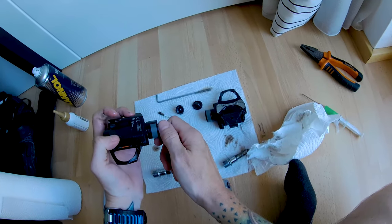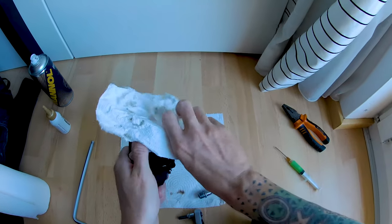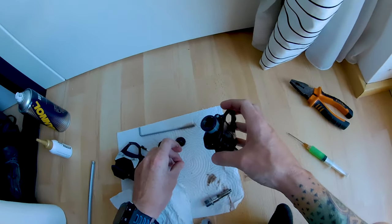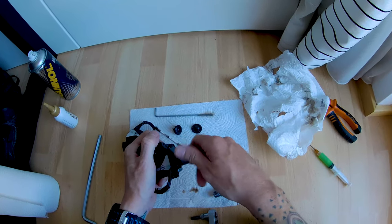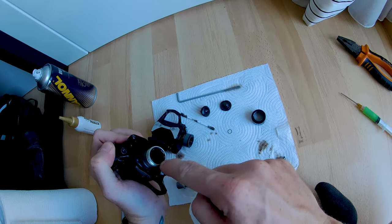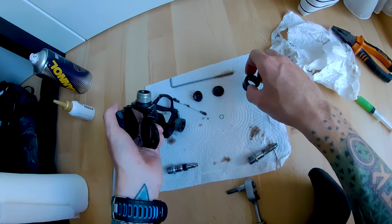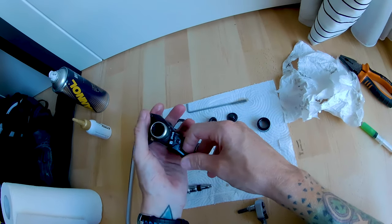Here is another ring — it's a little bit oily and a little bit hard to get off. If you screw this one off, you have the bearing seal here. This is the bearing seal, and if you pull the bearing out you have to remove the seal, and then you can put another bearing in. But as mentioned, they're quite hard to find because they use a special diameter which you can't find anywhere on the internet.